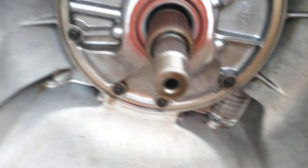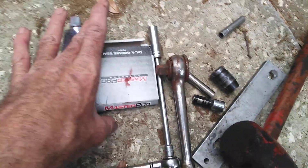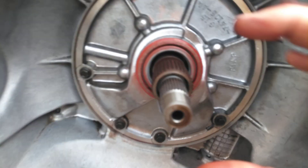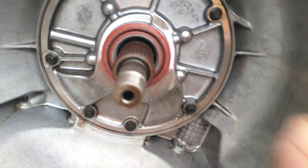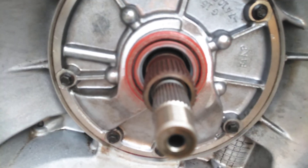Now to install it — since there was no silicone on the other one — I got a Master Pro seal and I put red high-temp silicone around it. I pushed it in by hand after I had the silicone on. Use high-temp red silicone; you need at least 500 degree temperature rating or more.